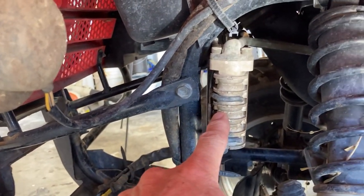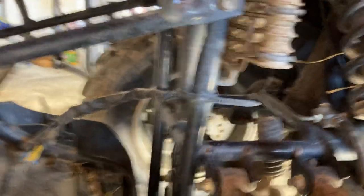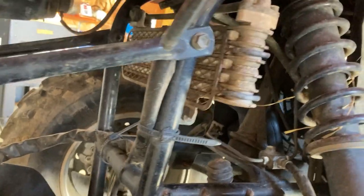It's an oil-cooled engine. We have an oil cooler right here where engine oil goes through that cooler and keeps the engine cool. Behind that there's a fan, and when the oil reaches a certain temperature, that oil temperature switch sends a signal to turn that light on. But also when the oil temperature gets high it should trigger that fan on, and that happens all the time when you're at idle sitting still — it'll bring air across your legs as it's bringing it through that radiator to cool the engine. But that's the first time the oil temperature light came on without the fan.